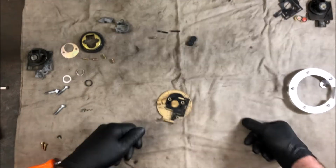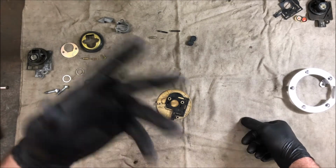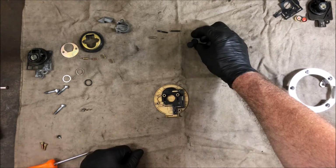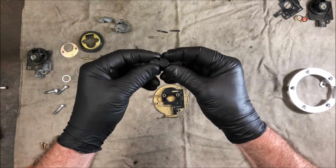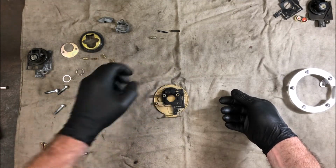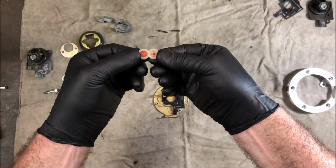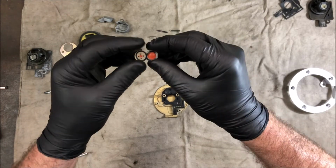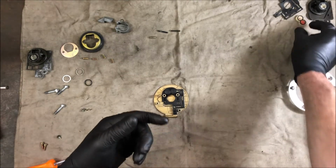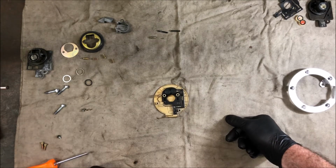This cap is off a carbureted Super Sport. So there's no vent circuit through the cap like there is on pretty much everything else with these caps. So this piece goes in next. This piece just basically blocks the vent system off. If it's a cap with a vent system, it has a couple little valves that look like this, that being the top side. And what this does is it allows the cap to vent, to suck air in, so the breather circuit through a lot of them is through the cap, and it comes out through the rubber grommet you'll see under the cap.